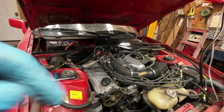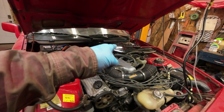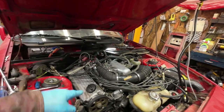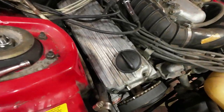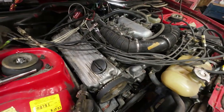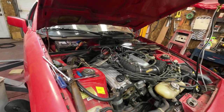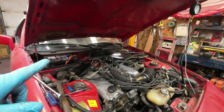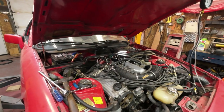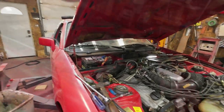Anyhow, now I'll put the plugs back in, and what's next? I have determined top dead center. I have the 3 degree mark on the flywheel and on here, and I think I got it right. Pretty sure I've got it right. And if it's not right, well, gee whiz, likely better than it was before. So 3 degrees after top dead center is the timing point with the gun. So let me get the spark plugs back into it and see if I can get it to run.